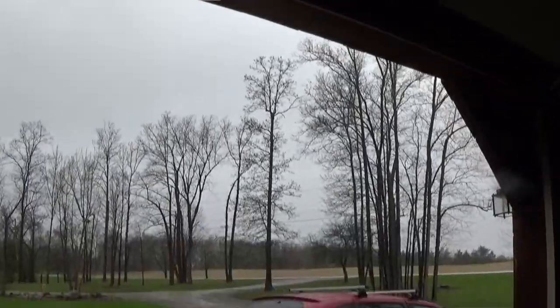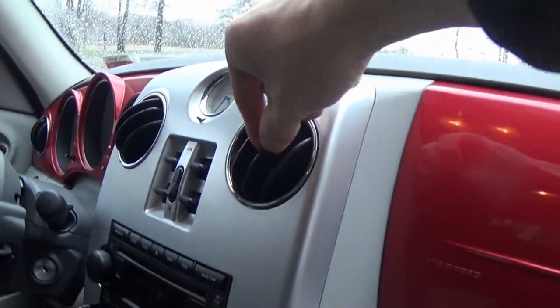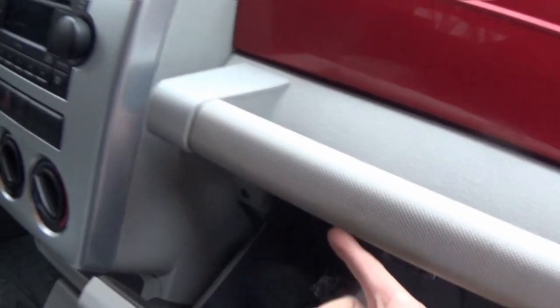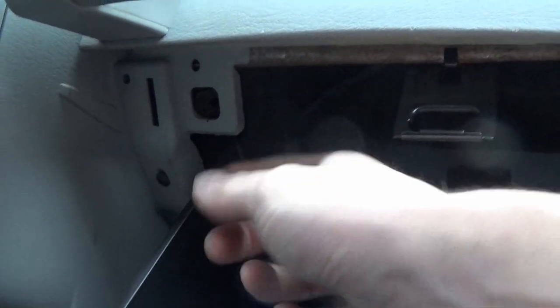But even still, we always have little things that need to get done on the daily. This was a fun video, but we have some other issues we need to take care of. I just found out today that my defrost is barely working and my windows started to fog up when the car was running earlier. And for the last couple months probably, these have actually been broken and they have not been blowing out. There's all the blend doors up in here and up through here. If you pop the glove box out, you can get access to the little valves and where the cables all meet up and control everything.